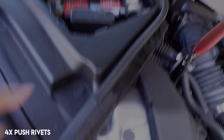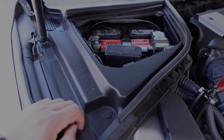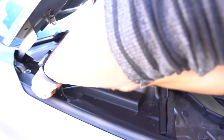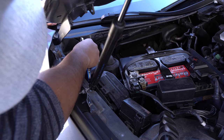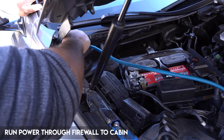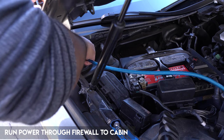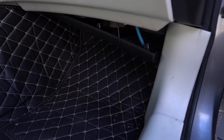To tap a power signal from the battery to the amplifier, I need to get through the firewall. I need to remove all these little clasps to get access to the battery area, and right behind the battery is a little grommet that you can pierce a hole in and run your power wire through the firewall. I used a little utility knife to cut about a one centimeter hole into that grommet and then pushed my power wire through.